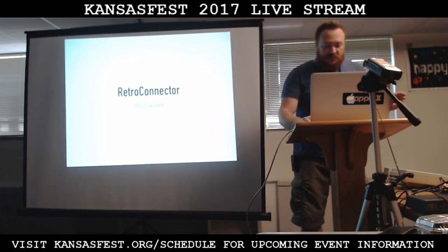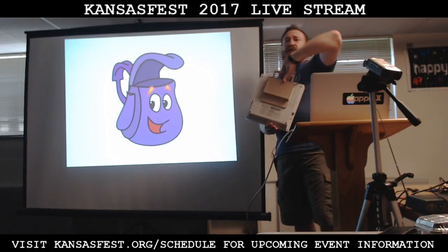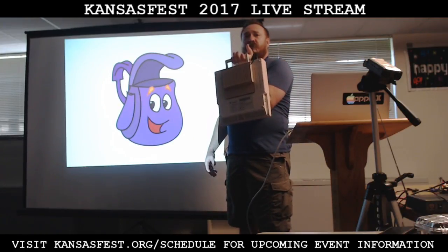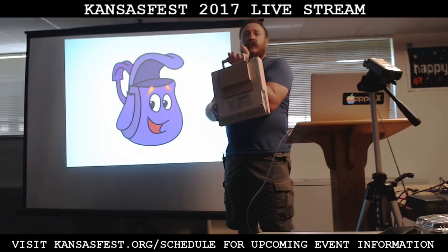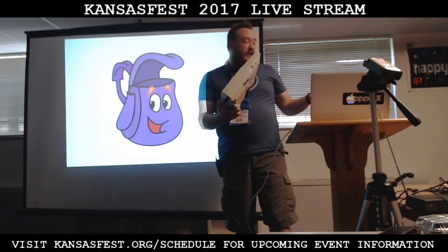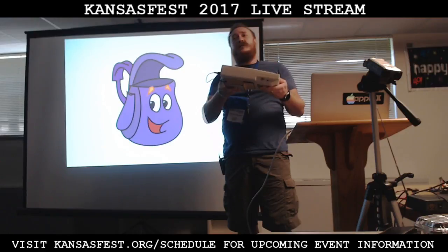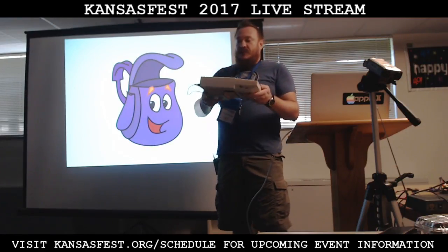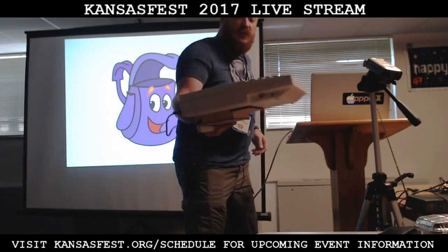Now on to my stuff. First thing that I'm announcing, I already talked about this on Wednesday night, but there weren't a whole lot of people there. This is the battery backpack for the Apple IIc. It gives you a 2.5 amp hour lead acid battery, 12 volts, charges with a simple brick, and plugs into the back of the Apple IIc. I'm sorry, it does not work with the IIc Plus, or anything else for that matter. It's a nice slim battery, so it sits underneath the handle when it lies on the table, so it's nice and flat.